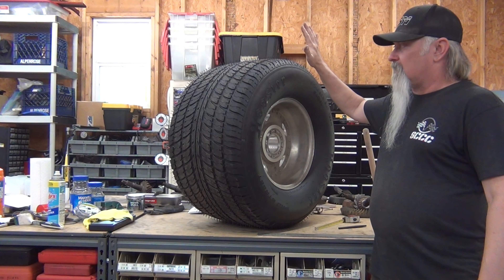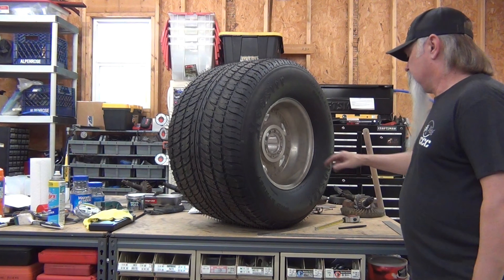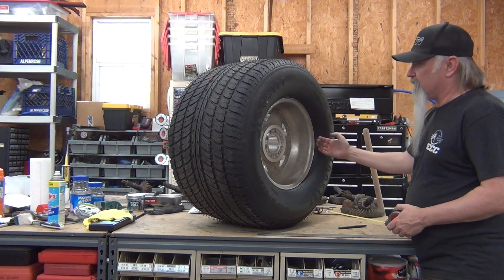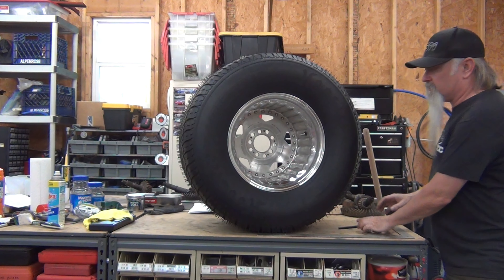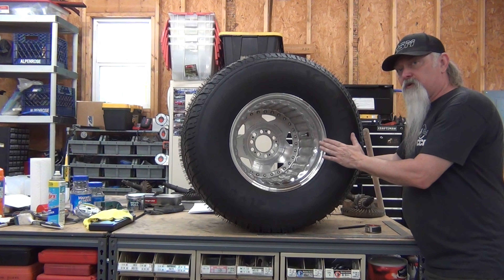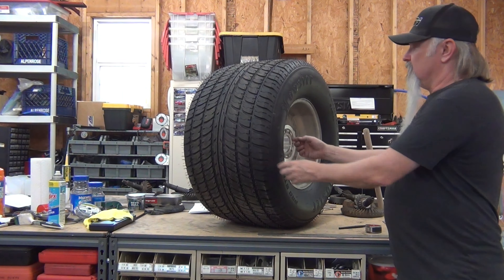Here's why. The wheels I would replace this with would be a fifteen inch wide rim. But the fifteen inch wide rims come with a four and a half inch backspacing. This is three and a quarter, so a four and a half is an inch and a quarter bigger. That means the tire will come out another inch and a quarter further back from this mounting surface. So an inch and a half difference in width, with an inch and a quarter going back, means only a quarter inch will come off to the front side. Normally if you were just increasing by a half inch, the sidewall would just move out about an eighth of an inch.